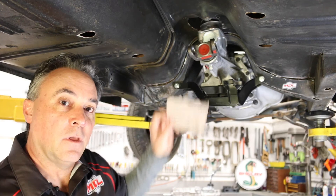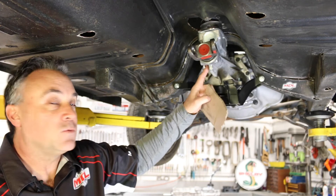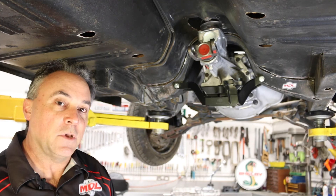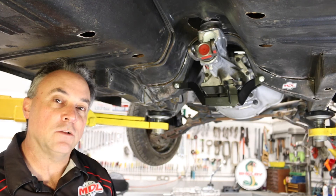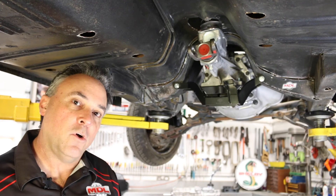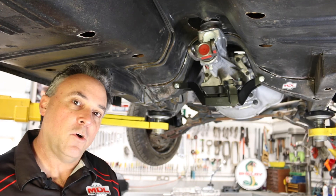One more feature we want to talk about — this is cardboard. When a T5 or any transmission is installed, it's rotational torque that happens. You don't need a lot of clearance between the transmission and the tunnel itself; about a cardboard's worth of clearance works, because as the transmission moves, it moves rotationally, not up and down. This concludes our T5 installation. Hope this video helps. We do have stills, so if you want any specific shots let us know. Check us out at moderndriveline.com or give us a call on our technical assistance line. Thank you for watching.